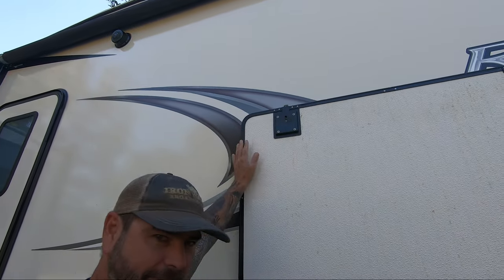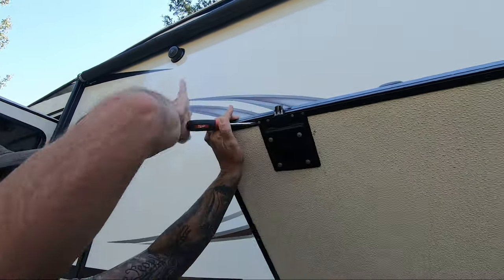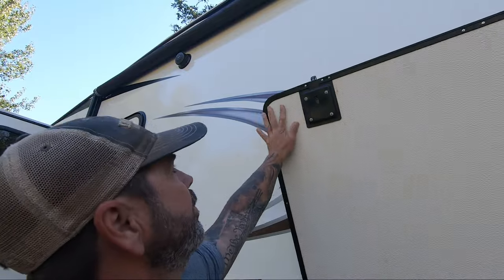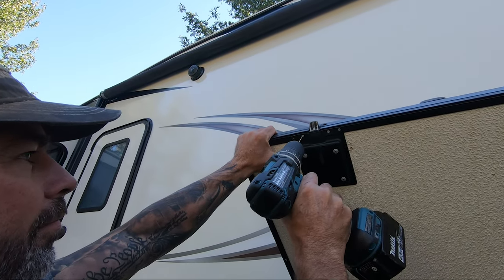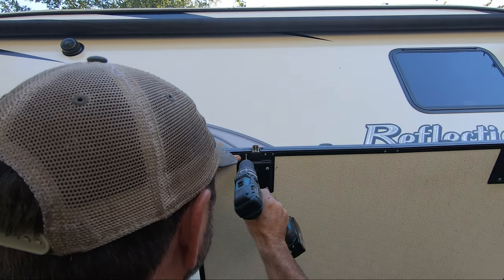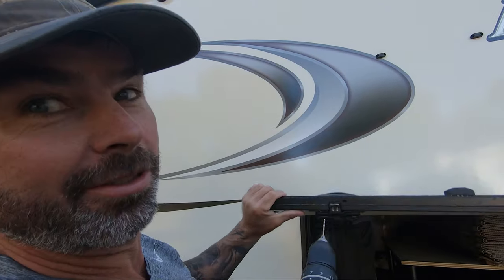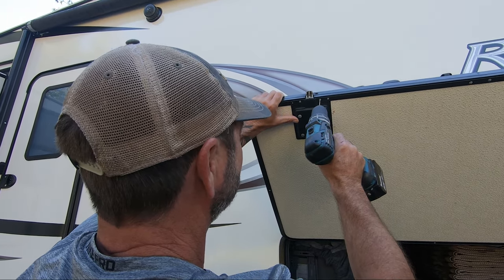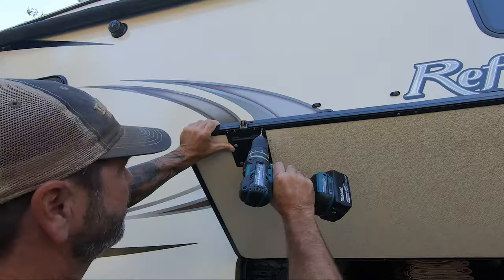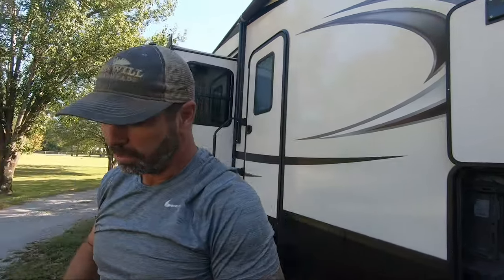I'm telling you, anytime you record anything, it never happens like it's supposed to. Don't press too hard or you'll go all the way through. Get the center drilled out, and we'll pop those heads off.